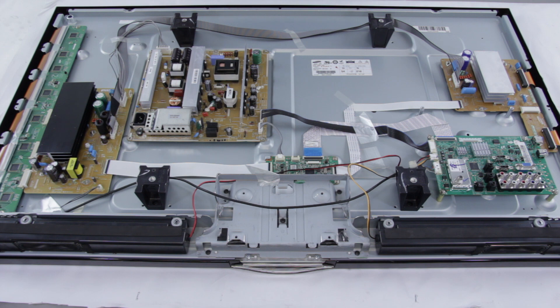The first part we are going to look at is the power supply, which is right here. The power supply takes in and distributes power throughout the TV. This board is either directly connected to your AC power cord or is connected to the AC adapter. Some common problems that can happen with your power supply is that you have a dead set where your TV does not turn on and you have no standby at all, so you know that you are not getting any power to the TV.